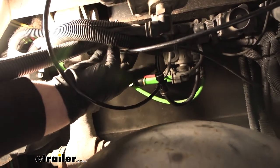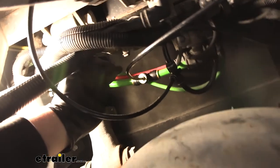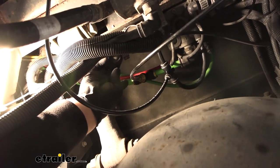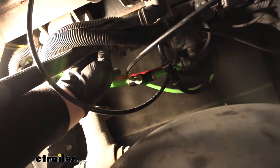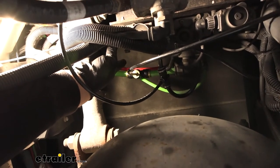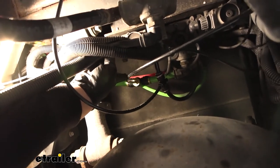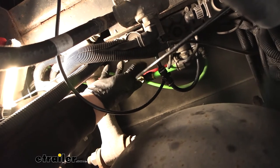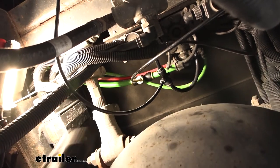When you do that, sometimes the factory lines will be dirty and have some gritty stuff on them. Make sure you wipe them down and get them smooth and clean. The next one will be our supply line. We routed our line over from the tank — the supply line is this big green line here. Did it the same way: cut it in half, teed everything in. With the supply line, though, make sure that you drain your tanks in the motorhome first so it doesn't have air pressure when you cut it. To drain the tanks, I usually get inside the motorhome and hit the brakes a bunch of times to deplete all the air. Once these are hooked up, one more line comes off our tank and runs towards the back of the RV where it connects to a fitting.